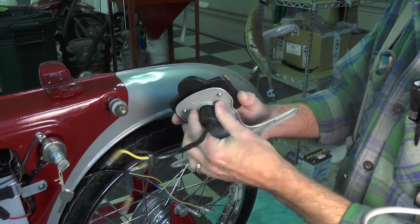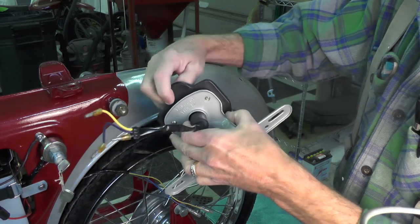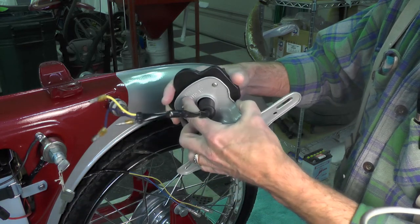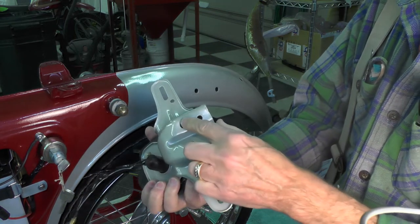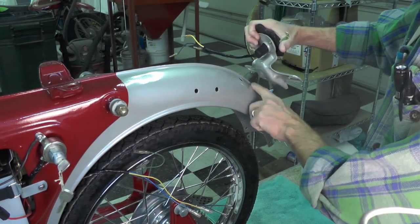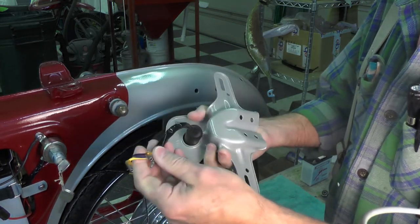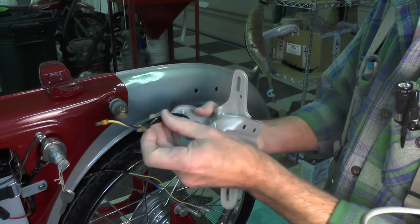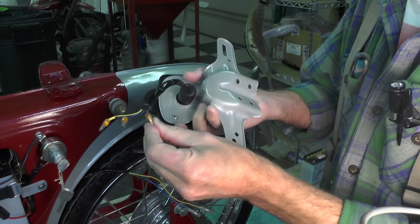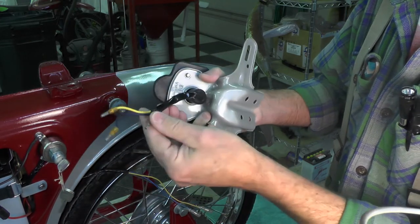The situation I have is that this is all rubber mounted. What I mean by that is the back of this bracket right here has a rubber pad on it, as you can see. And the tail light bracket itself has four rubber grommets that are used to insulate or isolate the bracket from the fender. Yamaha, in order to address the current flow for the wiring, added a ground wire right here — this black wire, the shorter of the three wires. That's a ground or earth wire.